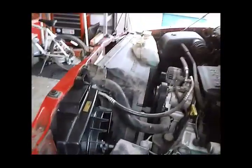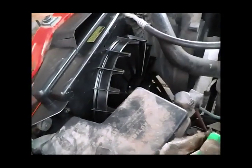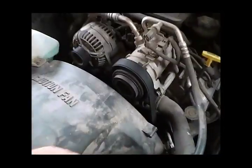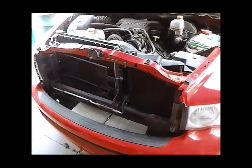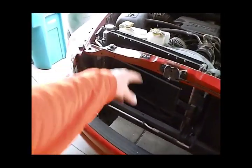Testing out the final repair here — nice and cold, getting there at least. Going to check that no weird noises are going on. The fan is drawing good flow, the vents are cool, no leaks, nothing rubbing, everything's good. The compressor is staying on and not cycling. One thing I recommend: this condenser is pretty dirty from bugs and road trips. If you have a quarter car wash nearby, spray it down, or just spray it with your hose and clean it out. While you're at it, do the radiator too.